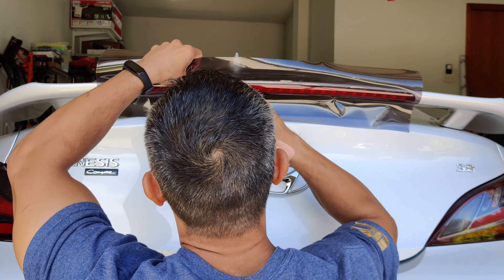Coming around that curve and corner as best as I can — you'll probably get a better angle here. I'm trying to make sure that I keep the blade between the gap so I'm not scratching the inside paint of the spoiler. Change your body position as necessary so that you get good visibility while you're cutting. I went to the front here to pop the trunk so I can look underneath the spoiler a little bit better.